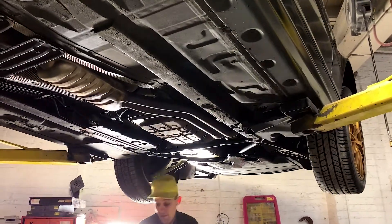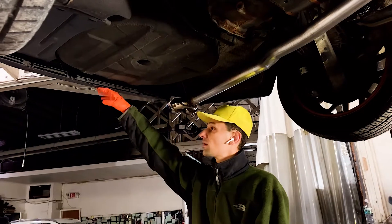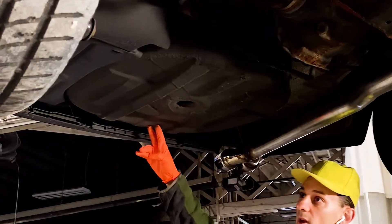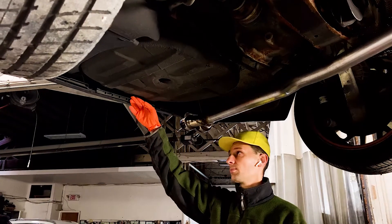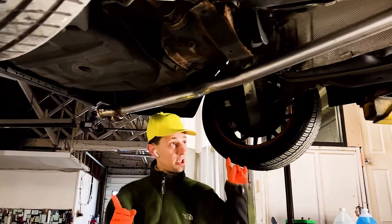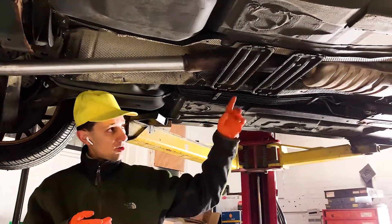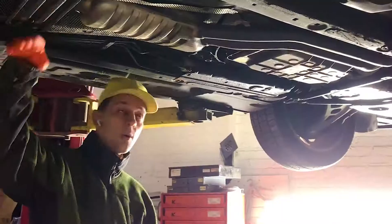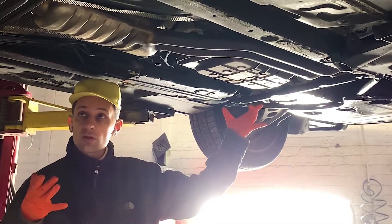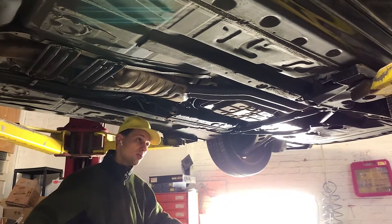Probably somewhere on the cover — I haven't figured that out yet. For the back, we have a spare tire compartment and the back bumper. Still debating — maybe right where the spare is, but also in front of the bumper, somewhere in that area. I always want to do the sides first. The biggest thing is you don't want to install it close to the exhaust because of the heat. I'll have to run the wires across one of these beams, keeping in mind that some parts may be removed in the future.